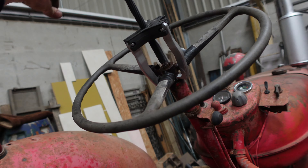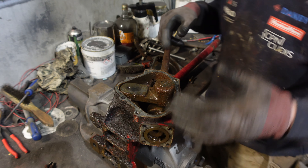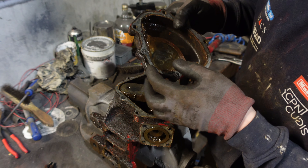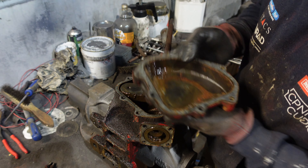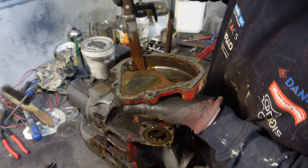When you take this shaft off here, that looks to be the foamy stuff that I've got replacement for — looks to be gold, brass. So it turns out them gaskets are shims, and the idea is to remove them as the metal starts to wear away, to take away the slack so it stays better. I had to remove all of the ones on this one, so the main shaft must have had some use or abuse. Out of the three shims on the side plate, I think we only removed the thin one.